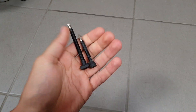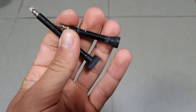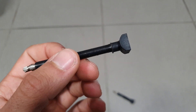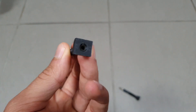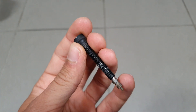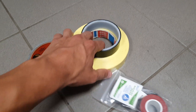Moving on to valves — most wheel manufacturers include their own valves with the wheels or rims. There are two general types. Some use a rim-bed-specific design, like this valve from a Mavic rim, which is needed because Mavic rims use a very deep, heavily sculpted internal channel. Then there are valves with a conical rubber bung, which work with pretty much every type of rim out there and are very reliable. If you go for that shape, there should be no problem.